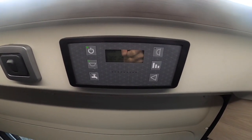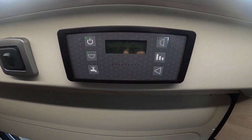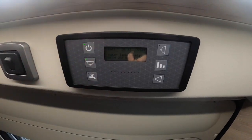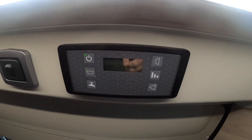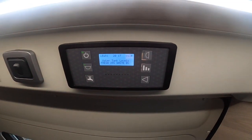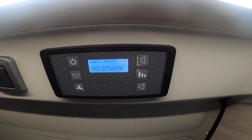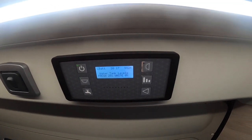Once inside the vehicle, above the habitation sliding cargo door you've got your main 12-volt control panel — a Sargent EC362. If you're hooked up, you'll have mains 240-volt power; if not, you'll just have 12-volt off your leisure battery. You've got your master switch in the top left-hand corner which turns the motorhome on and off, 12-volt or 240. Below that is the master switch for your lights, which are then individually switched around the vehicle. At the bottom you've got your pump — turning it on will pressurise the water, but only turn the pump on if you have enough water in the tank. Clicking through the panel cycles through: leisure battery voltage, vehicle battery voltage, and then water tank levels showing fresh and waste percentage. Always make sure the battery selection says 'Leisure' in capital letters — you always want the motorhome running off the leisure battery, not the vehicle battery.